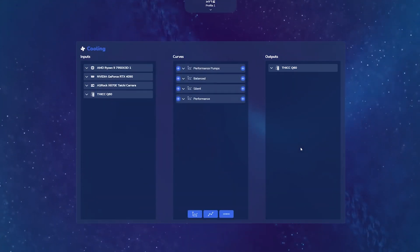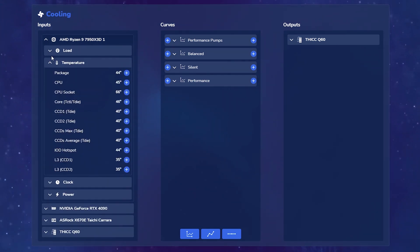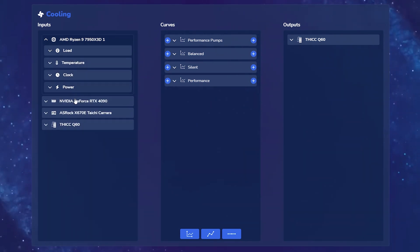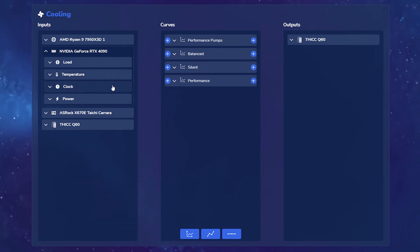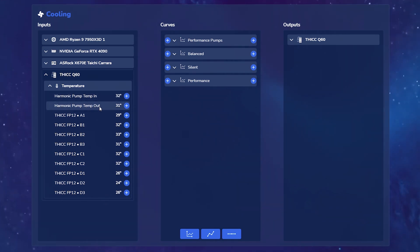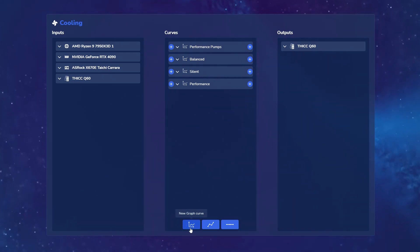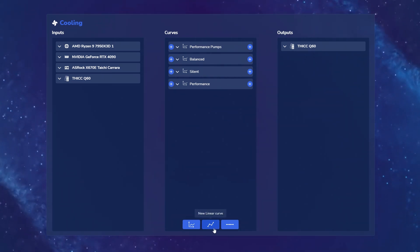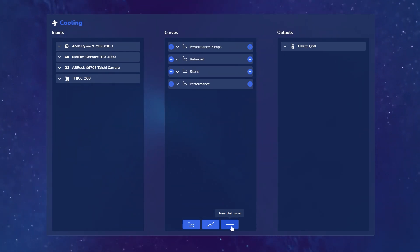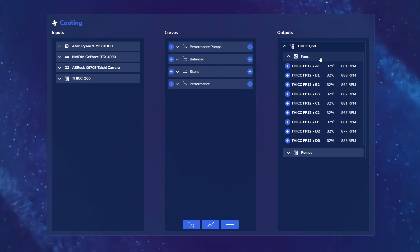In the Input section you're going to be able to select from any sensor that Nexus is able to tap into — whether it be your CPU load, temps, clock speeds, power, your GPU load, temps, clock speeds and power, your motherboard temps, as well as your Q60 pump temps for pump in and pump out, as well as any fan and the thermistor on that fan attached to the Q60. Then you can set that to any one of the preset curves or create your own. You can create a new graph curve where you can select each point, a new linear curve where you select three points that automatically manages the curves for you, or a flat curve which lets you set a static percentage for the corresponding RPM — and map any one of those to an available output vector such as your case or radiator fans, or the pump speed itself.